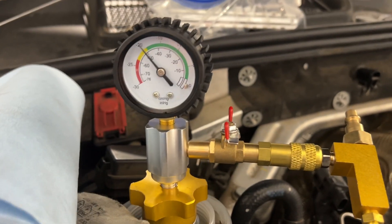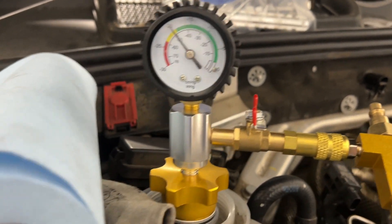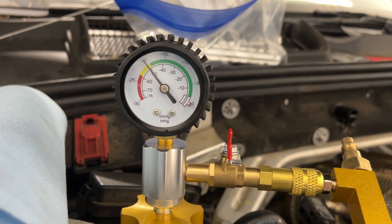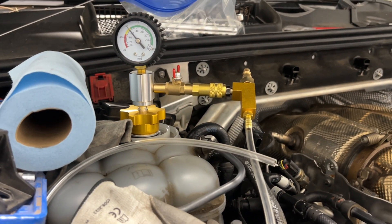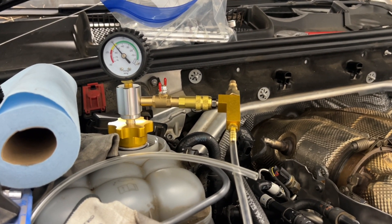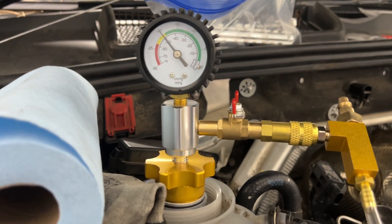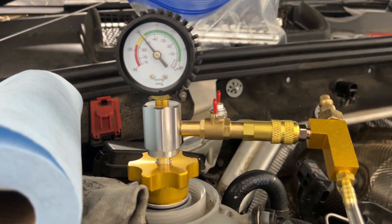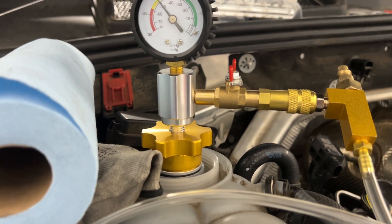Once you've got your vacuum pulled, you close this little check valve here, and that allows you to hold a vacuum on the system. This has been sitting for about 5-10 minutes, so we can confirm that we did hook up our coolant system correctly, that we have pulled a vacuum on the entirety of the system, and that it is sealed — because if it holds a vacuum, it's definitely going to hold coolant. Air is harder to contain than coolant is, so we did things right.